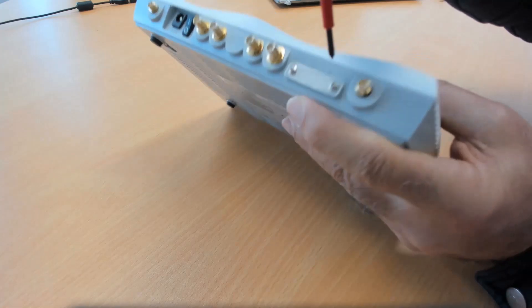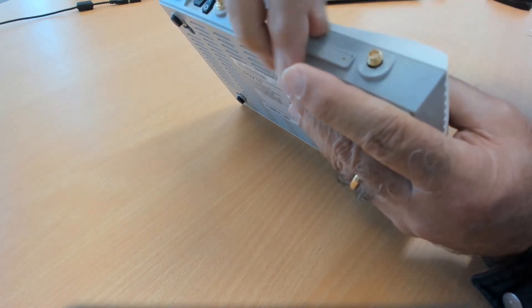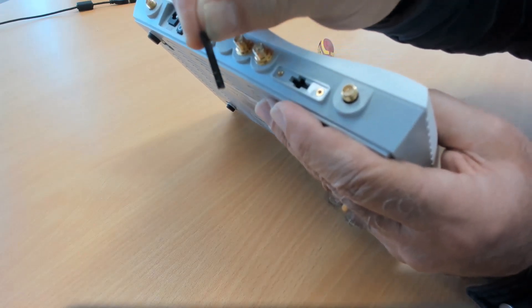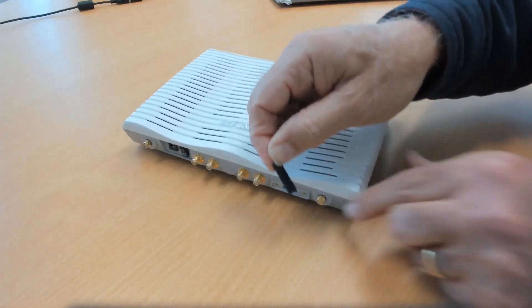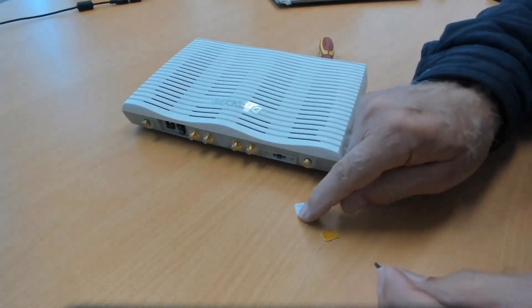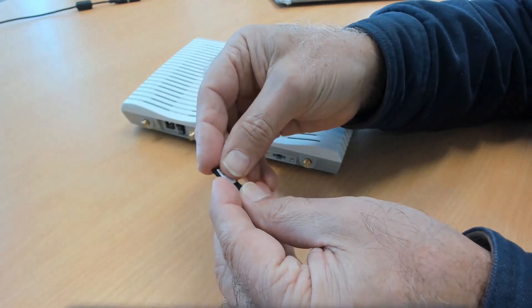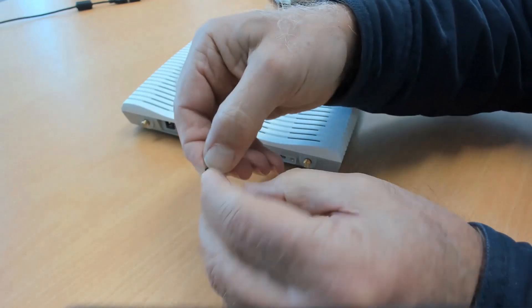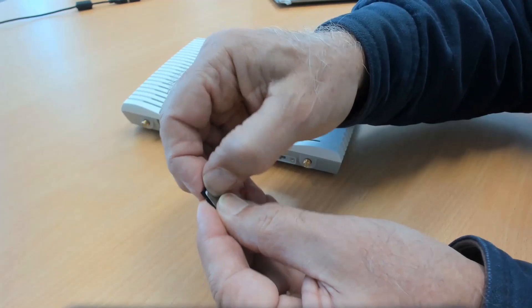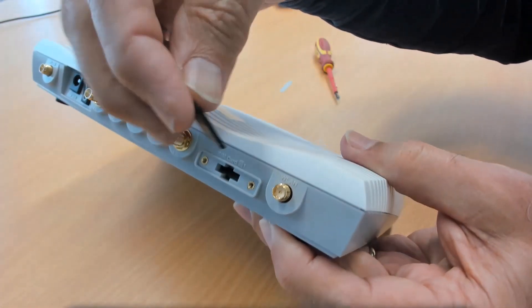We first need to remove the cover on the router's rear to install the SIM card. Remove the SIM card holder by first pushing it in and it will pop out. Notice that it has two sides so we can install two nano SIM cards. Let's install a Telstra card into the SIM 1 side and an Optus one into the SIM 2 side. If you're only installing one SIM card, install it into the SIM 1 side which will end up on top. Now carefully insert the carrier back into the SIM slot in the router and refit the SIM card cover.